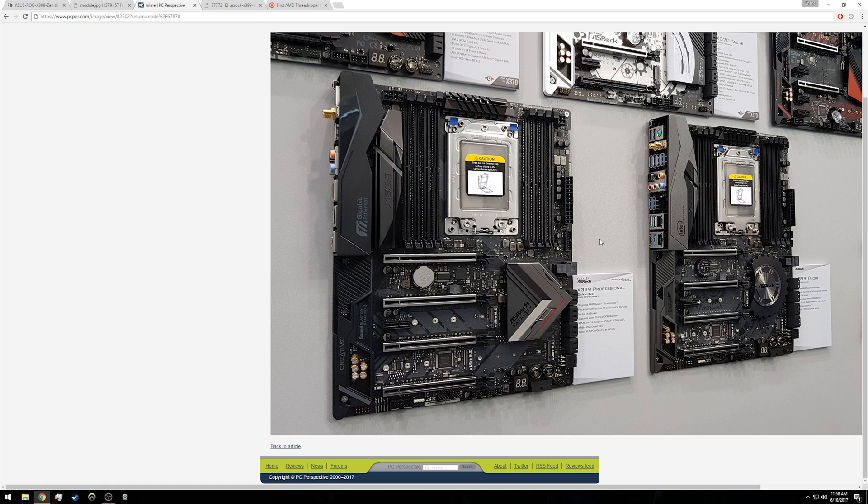For EPS power we have one 8-pin on the far left side, which is a more traditional location, plus a 4-pin connector on the far right top corner of the board. We also have two USB 3.0 headers for the front panel — one just under the 24-pin and another right angle connector at the very bottom. A nice touch is an LED number indicator that can give you error codes if something's not working correctly. However, one thing missing from these boards is a USB 3.1 front panel header, which isn't essential right now since most cases don't have that front panel connectivity, but it would be nice to see on a board for a brand new chipset in 2017.